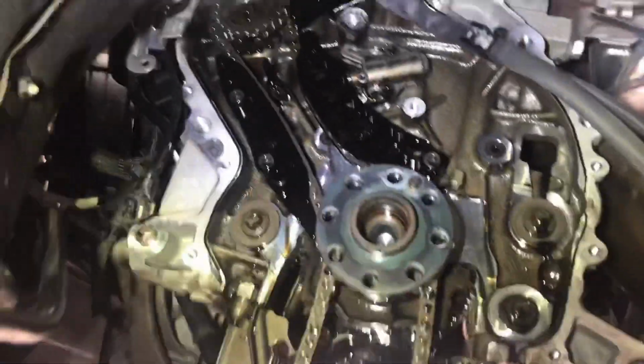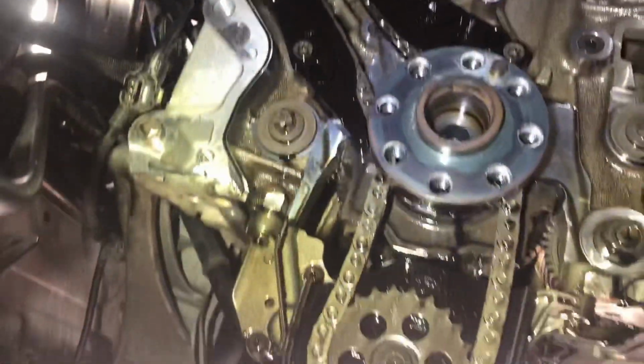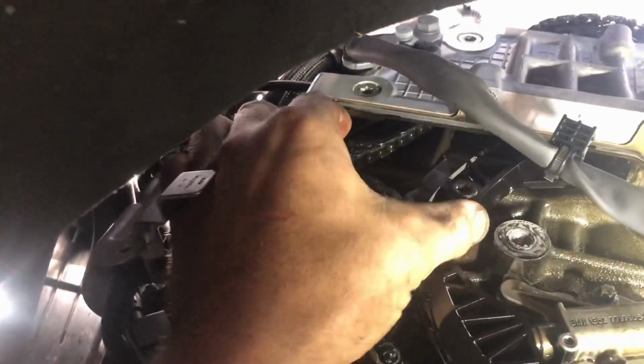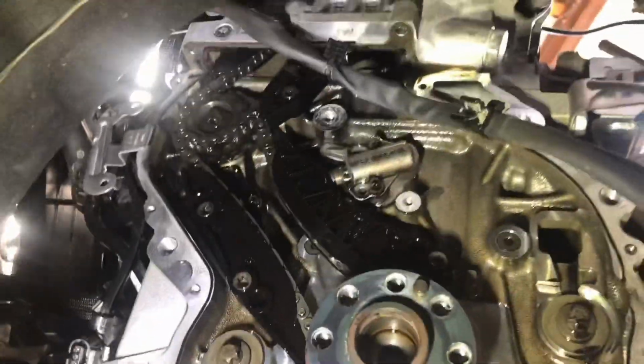So the back plate's off. On the offending article, there's the little guide up there. These plastic guides are what break. The chain goes slack, skips timing, see you later, mate. So what's the next job?